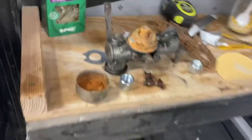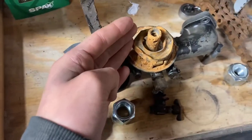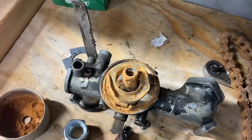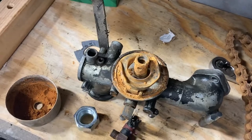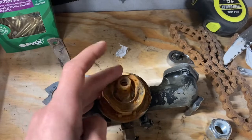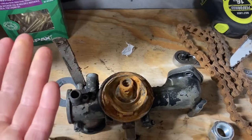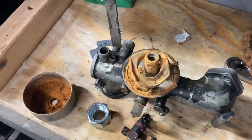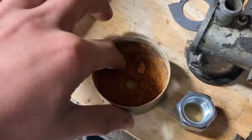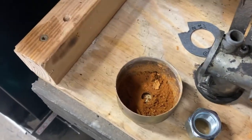Here you can see the carburetor — it's just really gunked up. I don't even know what happened to it with the original owner. The floats are all made out of brass because they're old vintage carburetors, but it looks like someone tried smashing it or something and it's just stuck. I don't know how this thing ran because it was obviously wide open — just flooding. And the bowl is just full of all this gunk — I'm guessing it's all dried-up gas, water, and whatever was in the old gas tank.